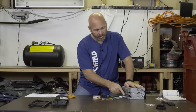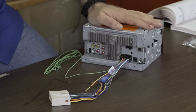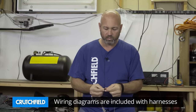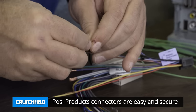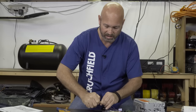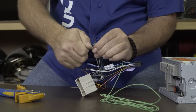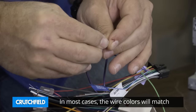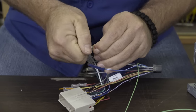We have here the harness that came with the radio and the harness that plugs into the vehicle — the vehicle-specific plug. We're going to connect these wires to these wires. I'll start with the ground wires, twisting the copper together, then take my posi connectors. We're doing these instead of soldering because they are so simple and easy to install and make a nice tight connection. Our ground wires are together and tight. The wires on both the vehicle-specific harness and the radio harness have been matched color for function: yellow is our constant wire, black is our ground wire, red is our switched power wire. There are a few extra wires on this harness we're not addressing right now — we'll deal with those later.